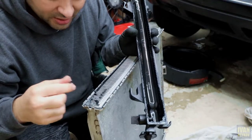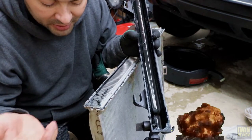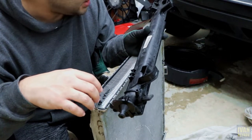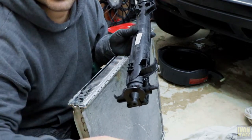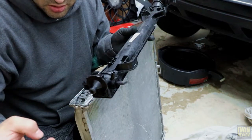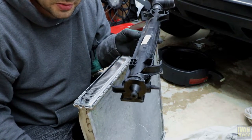That was the cause of my radiator failure. All of the bottom right here got plugged. The entire idea is that everything flows through the radiator and then goes out from the other side. When this side got plugged and the pressure was enough, it started to leak out. That's what happened — it started dripping.